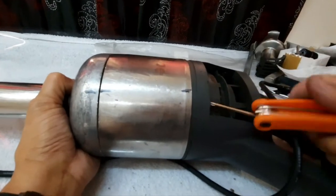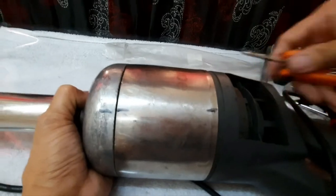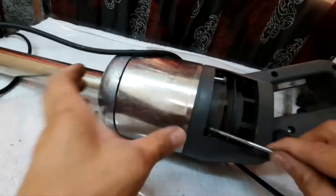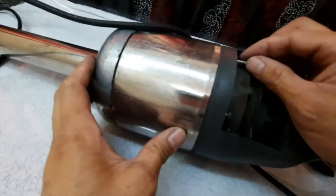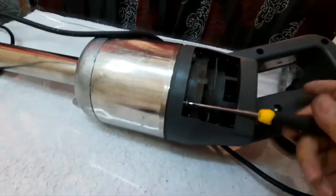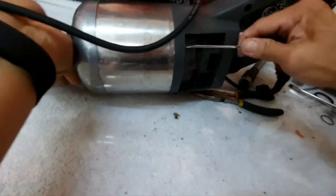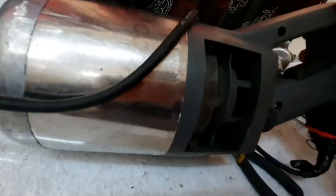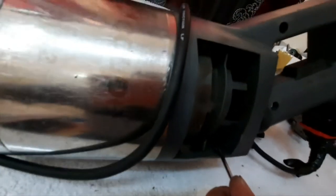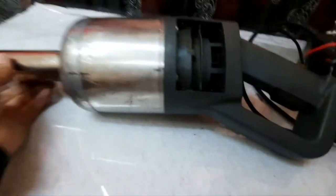Using your Torx, simply close it this way on one side, the same thing on the other side. Make sure that they are all tight. Once it's tight, you can check the rotation — if I turn the impeller here, the motor panel should turn as well. So if I turn the counter here, the other will be secured and connected. After we assemble and tighten all the screws, now it's time to fix back the cover.